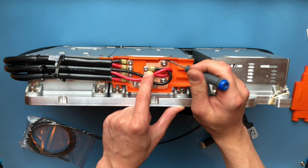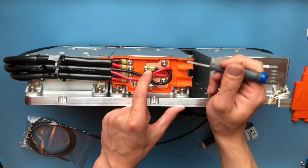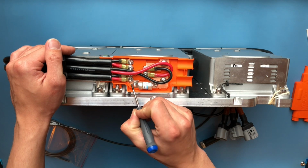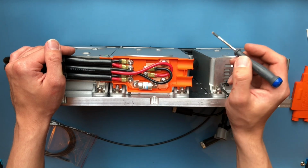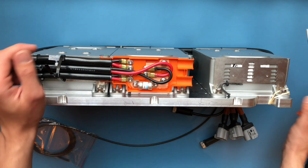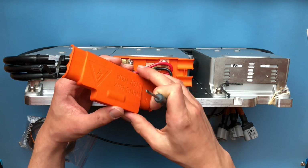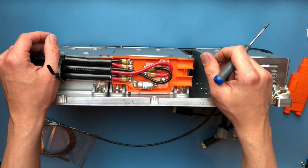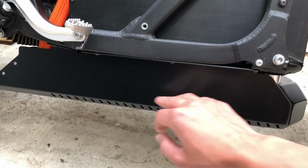But there's a difference. Our negative bus bar is a complete bus bar that goes directly to our motor controller, to our main B-, and our positive bus bar is separated. So we have a bus bar that gets all the charging leads together, and we then have a fuse, and only after the fuse with 100 amps we go up to the battery positive. We also can see in the 3D print we have a little bulge, so we can compensate for the height of the fuse. So we had just a little closer look at the DC splice box and the chargers itself.